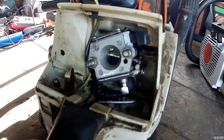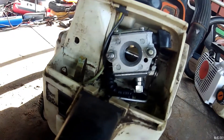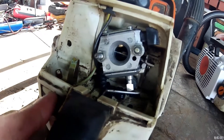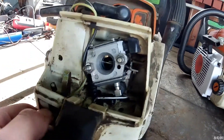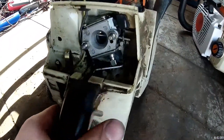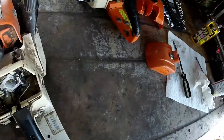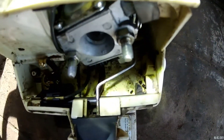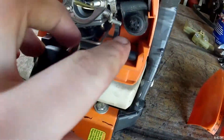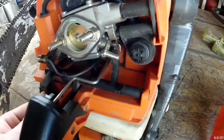When you put it into choke mode, the throttle is barely open, so it's virtually no different than idling — it's open just a little bit when you do this, but no different than basically just running. There's no choke lever in here. You can see in here there's a tiny little stub of a plastic piece right there, tied to the shaft. And this piece right over here has the same thing, but it goes to — guess what — the choke lever right here on the MS290. You can see that moving right there.